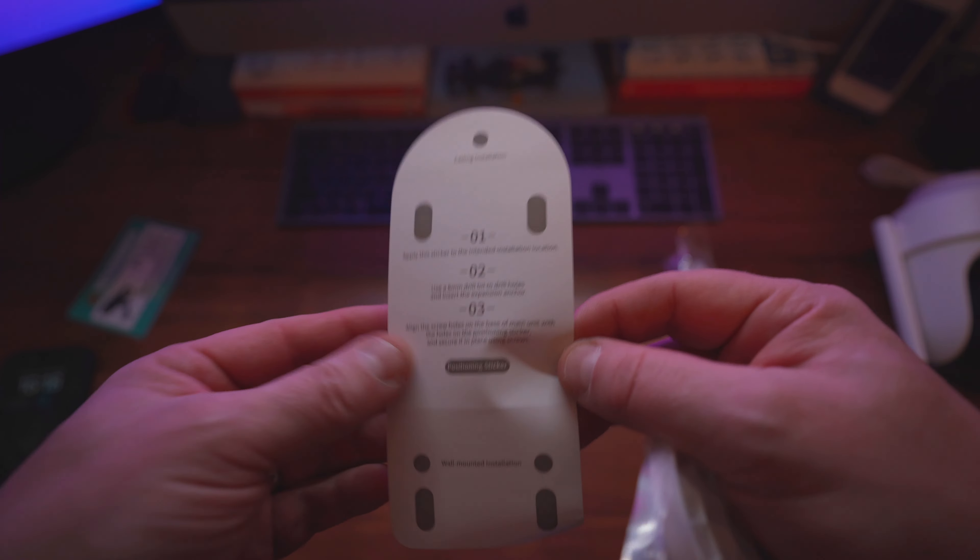You can have local storage up to 256 gigabytes — remember to format it to FAT32 and it will work absolutely fine. To access where to put the SD card, you have two screws on the back sealed for the IP66 rating. Take those screws off and inside you've got the reset button and where you put your micro SD card. From within the app you can also see recordings that have happened, and there would be your cloud recording as well.